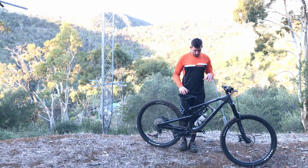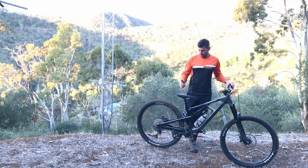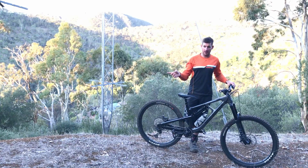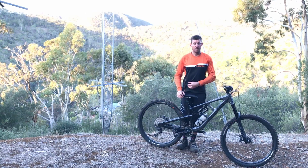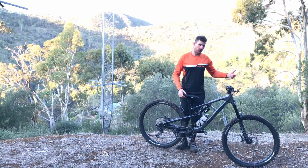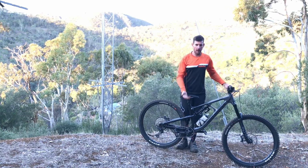So as it is here with 22% sag, everything open, everything normal, it was a really efficient climber. I put down the same times as I did on the Pole Stamina, which I'd set up to descend, so with the right amount of sag, everything was good. No lockouts or nothing, and that was the most efficient bike I've had. 140mm rear travel, 160 front. This thing's 165, 170. It climbs the same speed as that, but like I said, well oversprung.